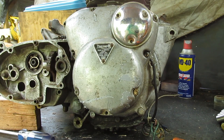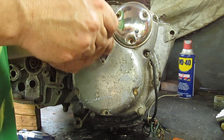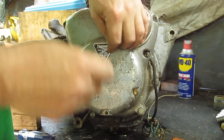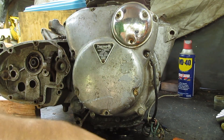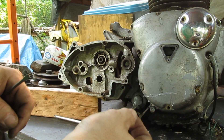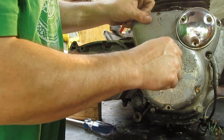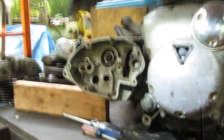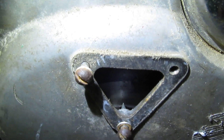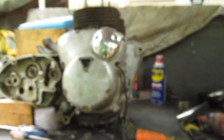Good news — there's no hole; why that tape was on there I have no idea. We are missing a screw but I have no idea why they had that tape on there. Let's get the little inspection plate off. Unlike the 500 motor, this plate is actually used as an inspection plate. It's an interesting screw — I'll have to look that up. It's a pointer: when you look inside you can actually see it in there. See that pointer sticking through the case? Then there'll be a notch when you rotate the rotor — a notch in there for your timing.